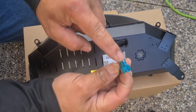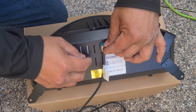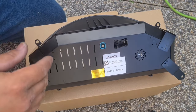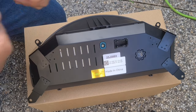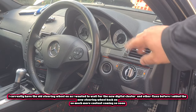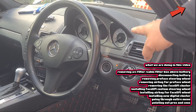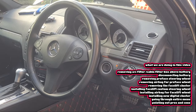Let me show you how you plug in the FAKRA cable. You've got the tab at the top — you simply line it up and plug it in. To remove it, just press on the tab and pull it out with a bit of a wiggle. Now let's jump in the car and remove the steering wheel, clock spring, and cluster, and install this. I still have my old steering wheel on, and you can see I already have the facelift cluster installed.